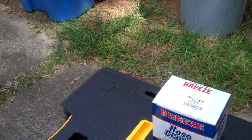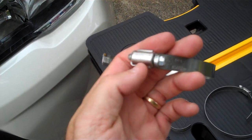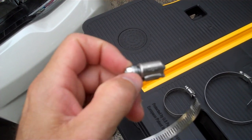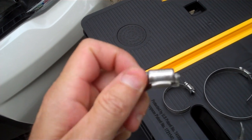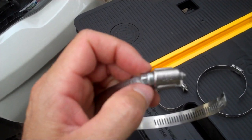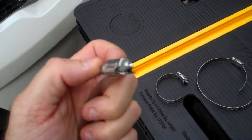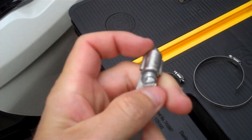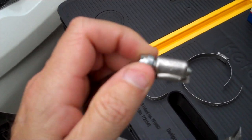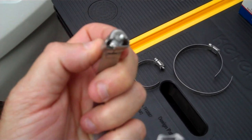So what we're looking at replacing are these Tridon clamps. If you look on your car, you'll see this stamped clamp that has Tridon on it. As you can see with the way this clamp looks, it's got less than 10,000 miles on it and this is just the way it comes. I haven't loosened or tightened this thing but one time, so you can see how much wiggle room and play is in this thing. It's really a poorly made clamp — I don't even think I would put that on a rain gutter on your house. You can't even hardly tighten it with your finger because it wants to hang up so much inside because it's so cheaply made.